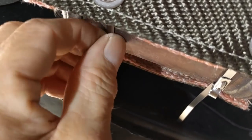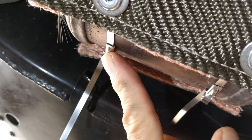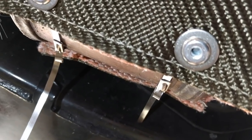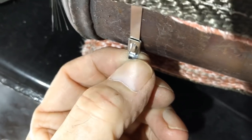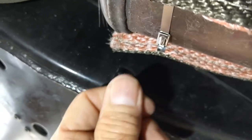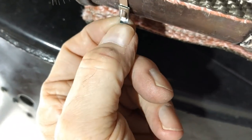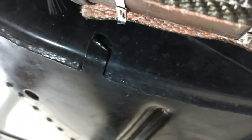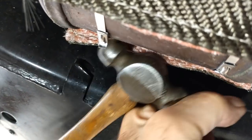You've got those tight. Then cut off the excess with a pair of side cutters and fold the end so the sharp edge is out of the way, and tap it down with a hammer so you won't scrape against it working under there. If you take your side cutters and squeeze real hard to make a dent in the material, then wiggle it, it'll break free — like bending a paper clip back and forth until it breaks. Tap both ends down with a little hammer to make them smooth.